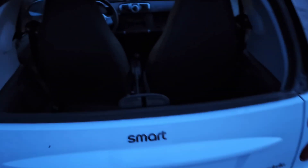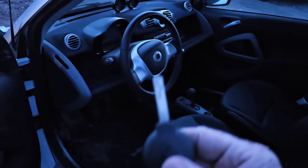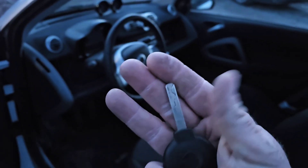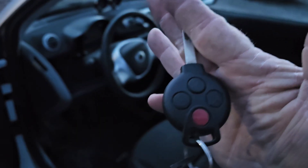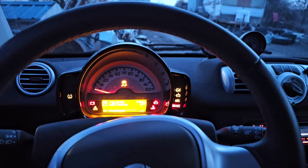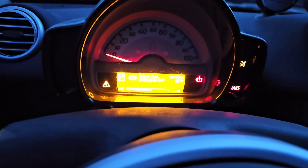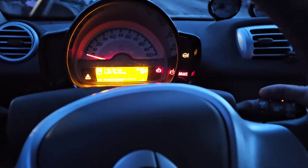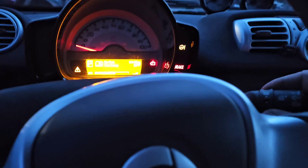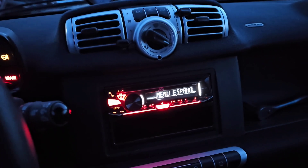It's getting a little dark. Put our cool little tailgate up, close the back window, and we'll put the key in and show you everything. It's got one of these key fobs — you can see the remote side with door locks, trunk, panic button, all that stuff. Let's see what it does. Turn it — windshield wipers came on. It says 'do not tow away,' and the message it's giving us is 'HV system workshop — drive system engine off.' That's what we've got to figure out.